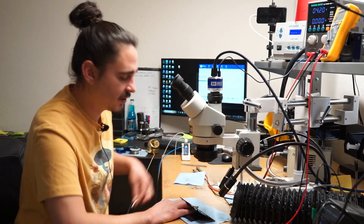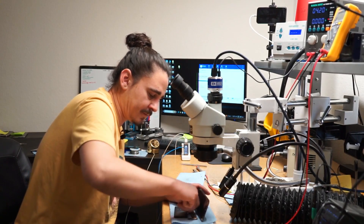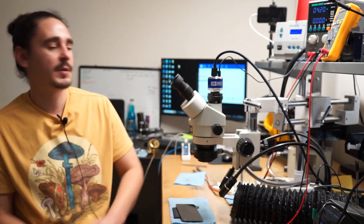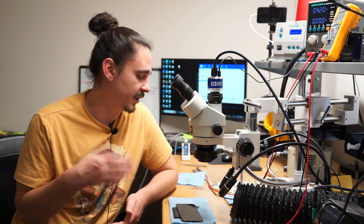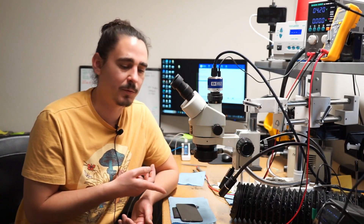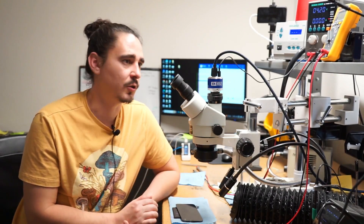I'll unplug it for now because I don't have a computer free to take the data, but it is booting. It went dim just because the proximity sensor isn't plugged in. I've been away a little bit and haven't been making too many videos because I've been very busy, but I want to start making them again. I do live demonstrations — I just chose this phone out of my queue. In this case it was the boost coil, which is a pretty common problem on the 12 Pro. Showing how the DC power supply reacts when we have this problem is a good symptom to know — just a very small spike that almost looks like nothing. That's what the DC power supply does when we have a boost coil that's loose. The customer's going to have access to their photos now and they're going to be very happy. Thanks for watching — hope you have a good one, bye.